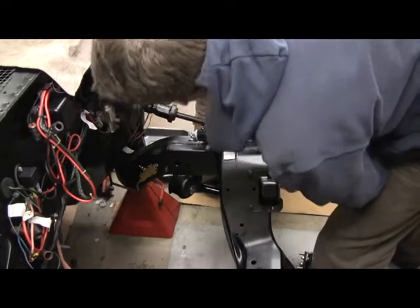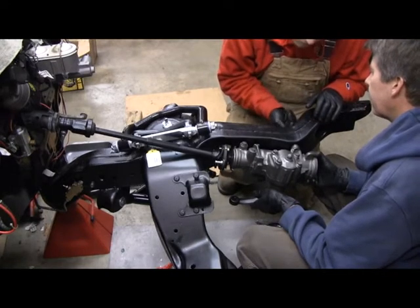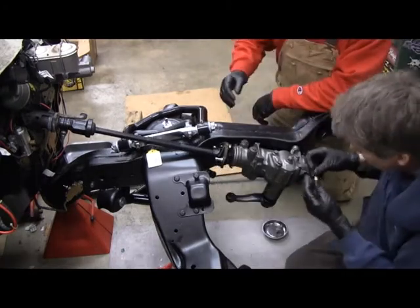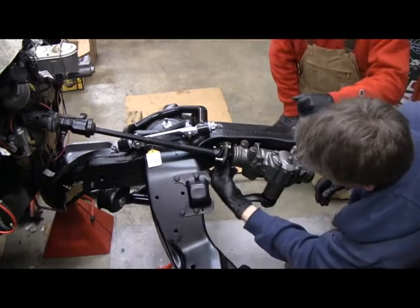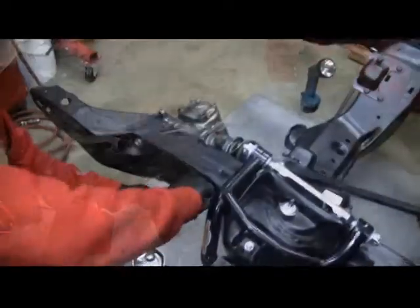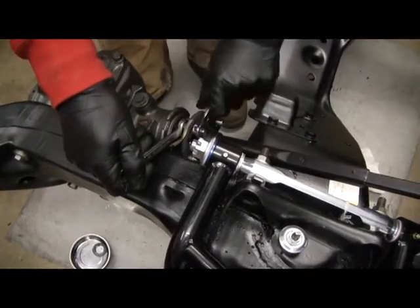It's supposed to go all the way up. We did have to redo the rag joint connection — it wasn't quite right how it was. But a little persuasion and it worked. All right, and the box is in. Tighten up the rag joint, and I'll double-check the torque spec for that too. Just kind of snug them up — there's the one on the bottom too.